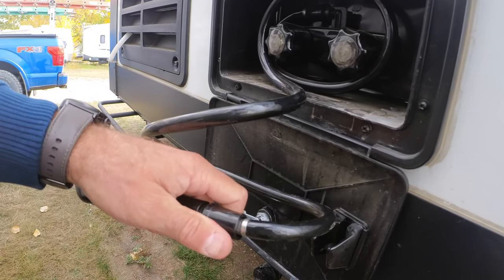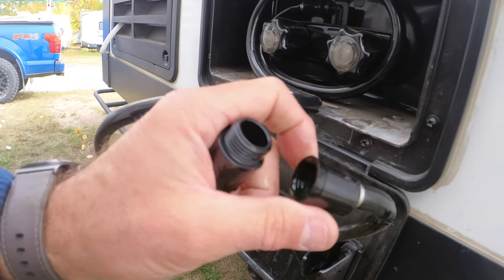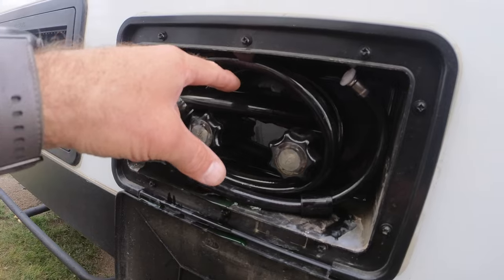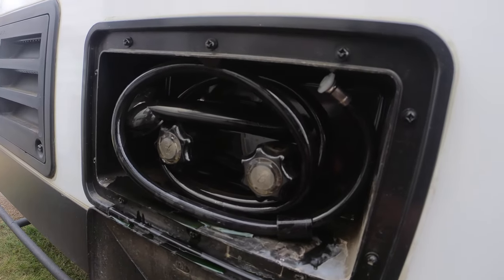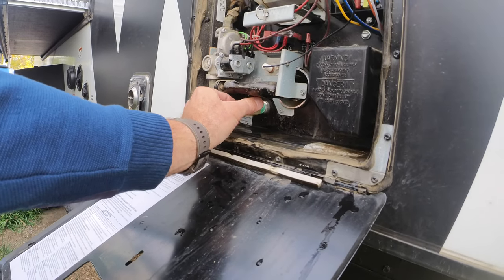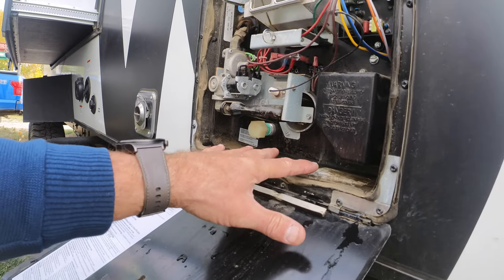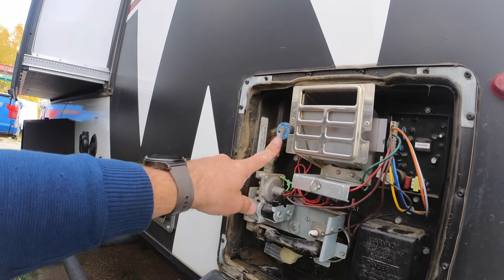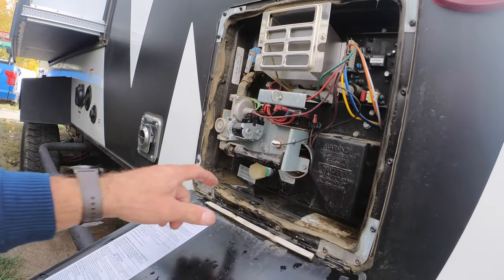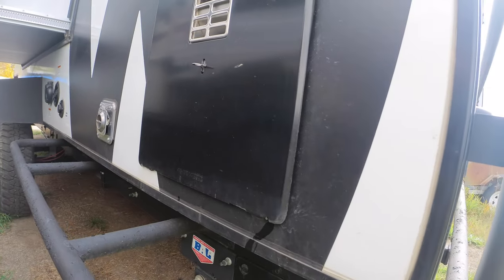I like to remove the actual shower head so there's no pressure build-up — you don't have to, but I do that sometimes. Make sure you watch for that little seal that popped up so you don't lose it — I put it right on top of the faucet. Since I'm outside, I'll just lightly screw in the drain cup — I don't want to screw it all the way so I don't create any pressure in the hot water tank, since there's no antifreeze going in there, just drained. Close your valve on top and screw the cap on loosely.